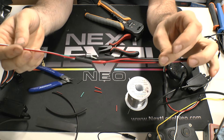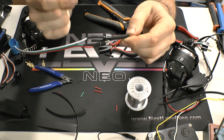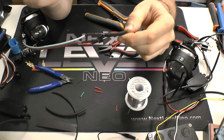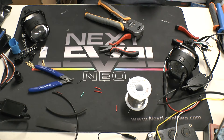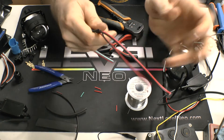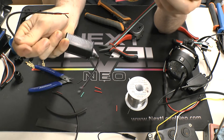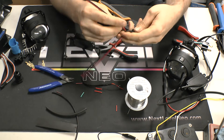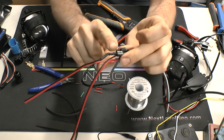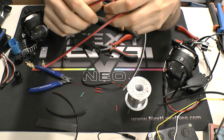That's all it was — it's not too complicated. The biggest thing, and I get this messed up a lot, is remembering which way the power flows, because if you get it backwards nothing's going to work. I'm going to hit this with some heat on the shrink tube. Just remember your low beam was the one coming off of both diodes, and the high beam is the one that only goes to the one diode on the front side.